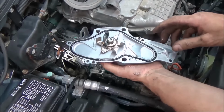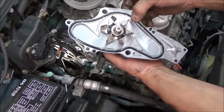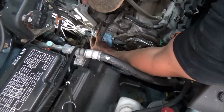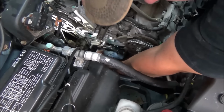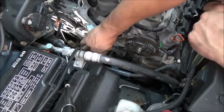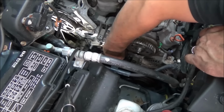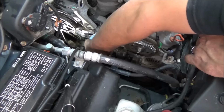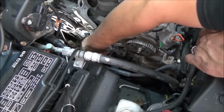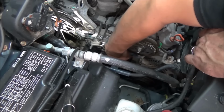You can see, I didn't show it on the other pump, but you can see those roll pins or hollow dowel pins. That's our locator. So once the pump's off, we're just going to come through with a towel or something. You want to make sure that sealing surface is clean. Even in the environment we live in, I've never taken one of these apart and seen them real crusty or nasty. So there's never a need to come in here with a cookie wheel ever. They're a pretty precise fit, so typically you just have to wipe them off.